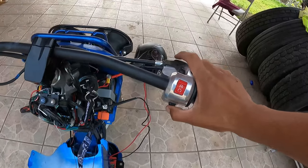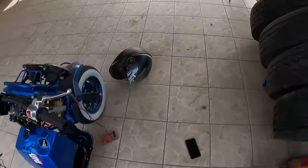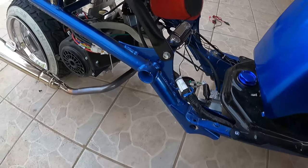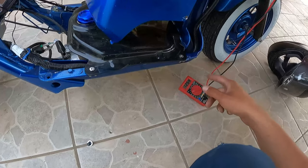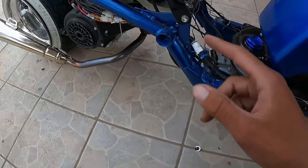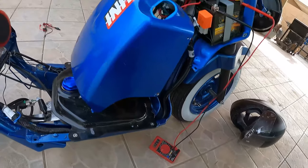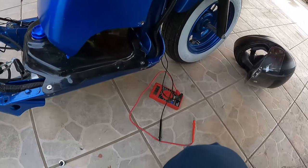Oh, I had the kill switch on — that's why it wasn't starting. Alright, so what I did find out — I couldn't really show you guys because every time I gave it gas it wants to take off and I have the brake on. What I figured out is that as I'm driving and the scooter is moving forward and revving up higher, as the revs go up it actually charges the battery — not at idle. But with the LED lights and the headlights on it does charge it, so I'm not worried about that anymore.